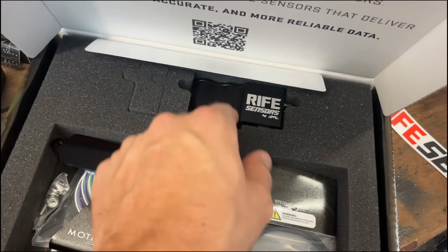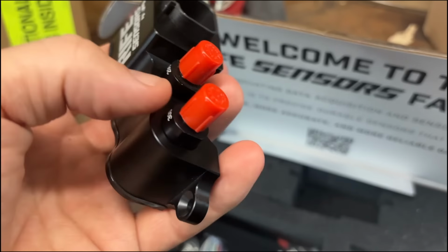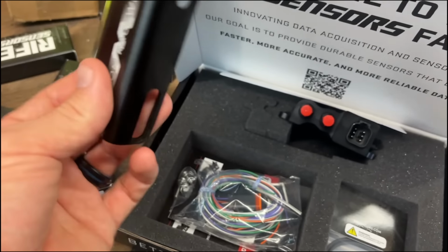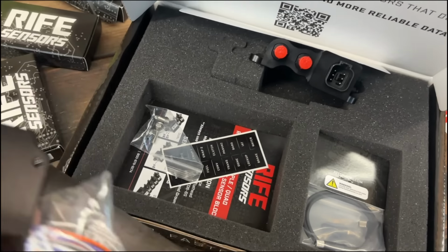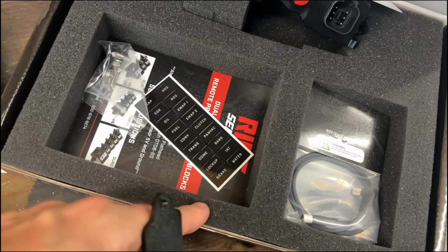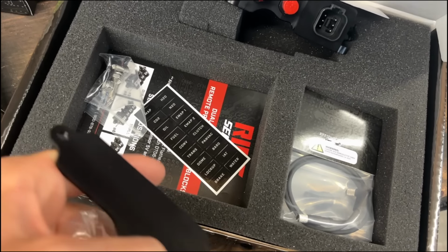I just love the way that these boxes work. It's like a sensor box. You just wire into there, and then you have 2 temperature sensors here and 2 pressure sensors built in here, but it just makes it nice, clean, and simple. And then it comes with a bracket to bolt it to the transmission. So you just drop the trans, unplug the one wire, and call it a day. It's even got stickers for what you need, depending on what you're using this for. If you're using it for like pan vac, MAP sensor, H2O, so water temp probably, all kinds of good stuff.